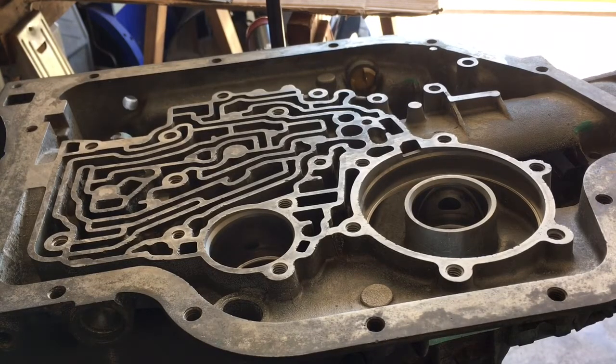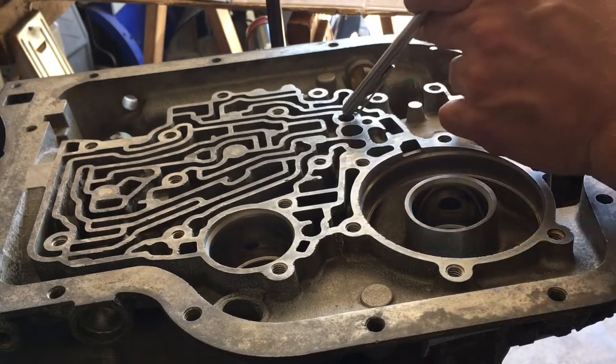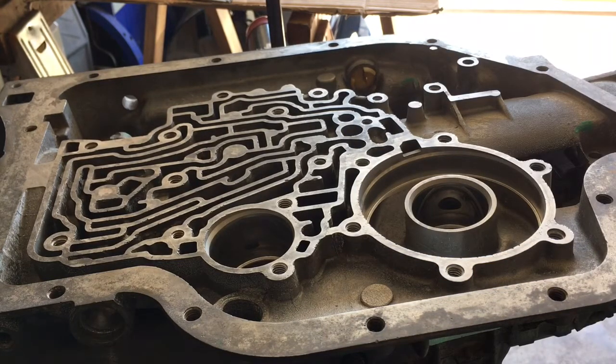Okay YouTubers, I'm going to start doing some of the modifications to assemble the Turbo 400. The first and most logical to start is putting the 3/8 cup plug into the case. This is part of the restriction of the reverse circuit when you do a dual feed on your direct clutches. Basically, this hole is where your center support bolt goes in, and the hole right next to it is where you drive in a 3/8 cup plug — part of the process to a fed clutch. You put a thread into that port beside the center support bolt.